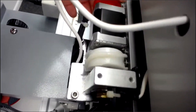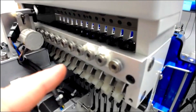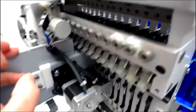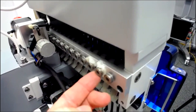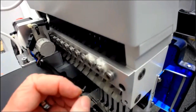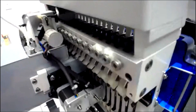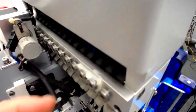The other thing I want to show you is the grease buildup here in the rollers — that's too much grease. There was too much grease on the color change cam when this machine came in from the factory. If you do put too much, it's going to gather on these rollers and they won't be able to turn smoothly — this gunk will build up and possibly cause issues. So just take a paper towel, clean this off, and make sure you only have a very thin layer on that color change cam. Your machine should come with no excess grease in there.